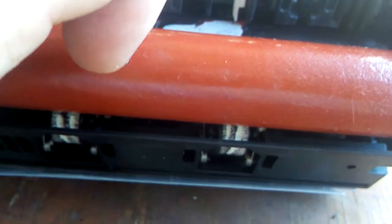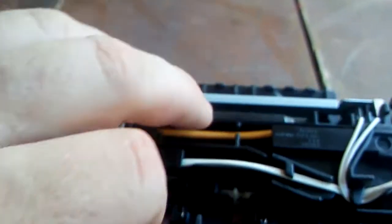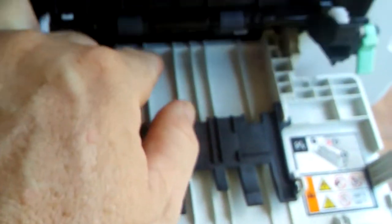What typically happens is the gold finger will fall into the paper tray in the bottom of the machine, or if you go looking around in the back of the machine where the fuser sits. So when it tears it off, it will fling it out, and it will either be sitting in here on the plate or it will fall down below, and if you pull the paper tray out, you'll find it sitting in the back here in the paper tray, or alternatively it will also be sitting up here, right up the very back of the duplex unit. And that's the duplex unit which flips the paper over.